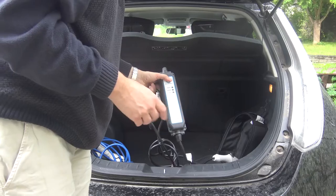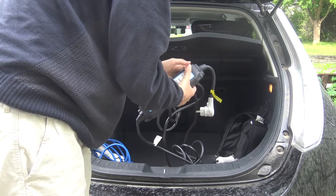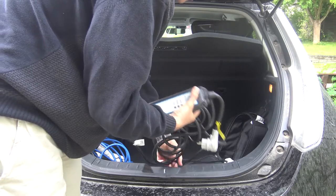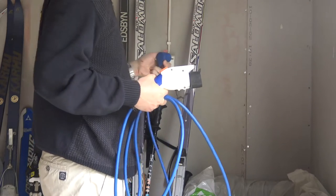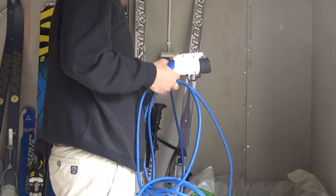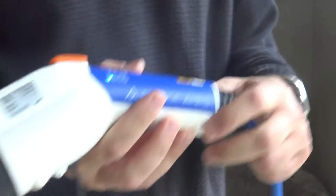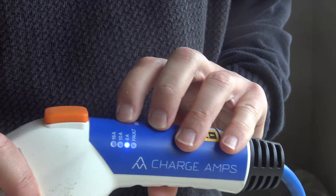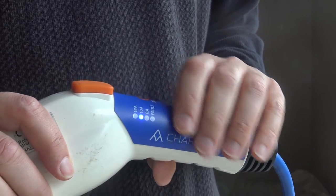Using 10 amps — not more, not less. And if you come to a place and want to charge your car but it can't handle a 10-amp fuse, you will have a problem. Therefore, I also bought this more advanced cable where you can actually adjust the amp setting depending on how much and how fast you would like to charge the car, and what capacity your electric installation has.